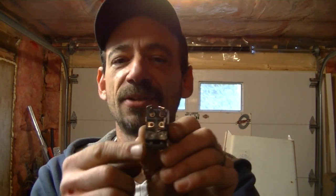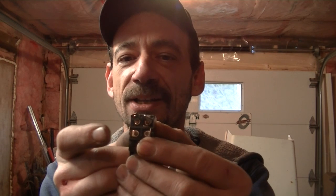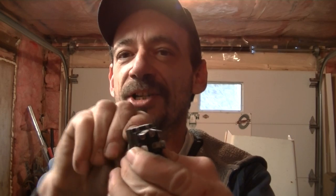How it works: I took the primary side — the kill wire — of one coil to one terminal on one side of the switch, and the kill wire from the other coil to the other side of the switch. These don't ever come in contact with each other. Inside this switch are two moving contacts — one for each side — and the two shall never meet. We've got one coil coming in on one side, the other coil coming in on the other side. Then we tie the two output terminals together with a wire and run it off to ground. When the switch is in the kill position, everything gets grounded out and it shuts the engine down. When it's in the run position, the two wires never meet, the two circuits never meet. That's the cheap, I-already-have-a-switch way of getting around the diode problem until you can replace them.